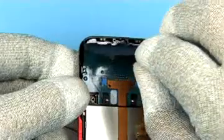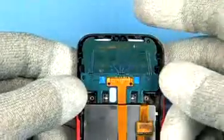Carefully bend the A cover on both sides until the clips of the top key mat support are released. Lift up the top key mat support. Lift up the top PWB — the top key mat assembly can be removed now.